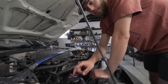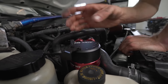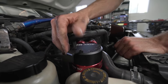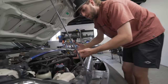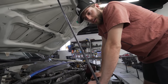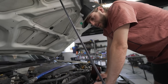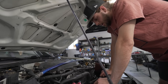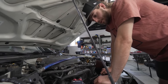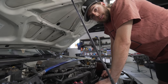When looking for a catch can, I want to mention again the dipstick. I can't unscrew it right now without taking off the two 10-millimeter bolts and pulling the catch can up — but with this dipstick you don't have to waste your time. So when buying a catch can, something like this from Add W1 with a dipstick is a good idea to save you time. I'm assuming it'll only fill up on drift days when you're banging the rev limiter and blow-by is happening more — regular driving, not sure; we'll find out and let you guys know. Do your research on PCV and how it works, and we'll do our best to explain it again in the next video so you're not harming your engine. Thanks for watching — later!